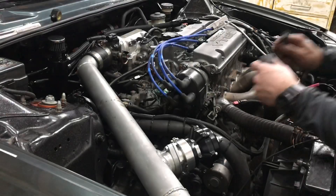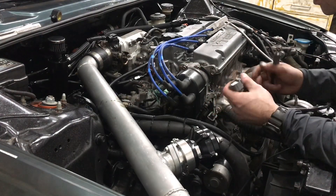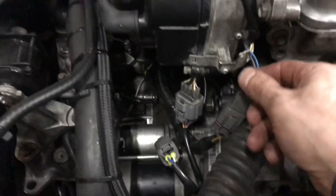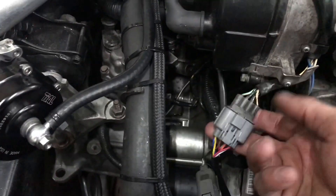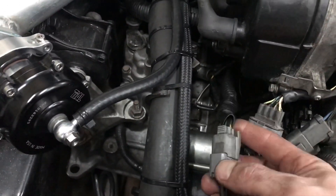Now I've got to take the distributor off. Once you get the old distributor swapped out and the new distributor swapped in, you can start connecting your Rywire harness assembly. Here is the plug that goes from the distributor into the stock harness. This is the plug that goes from the Rywire to the distributor, and then this is the Rywire to your stock harness.